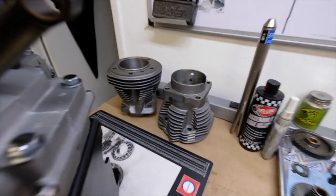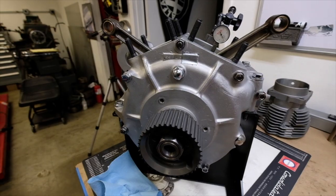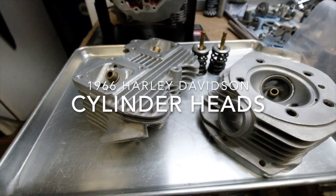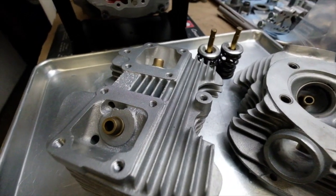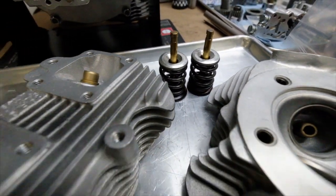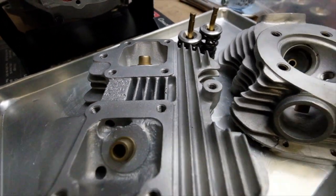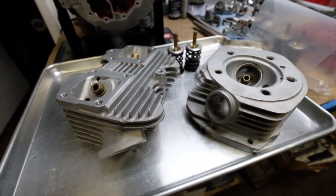Getting ready to do some painting of the barrels and continue with this build - it's starting to look like a real motor. I have the cylinder heads all apart here on the table, and while I had them off the bike I figured it'd be a good time to clean them and put them through the vapor blast. I did inspect them and found that the valve guides are rather worn out, so I'm going to send them off for a valve job - lap the valves in and put them back together.